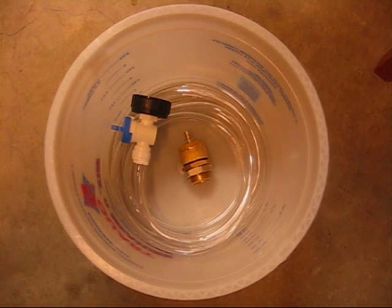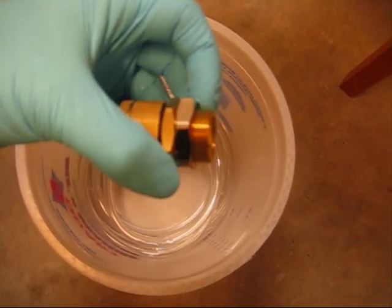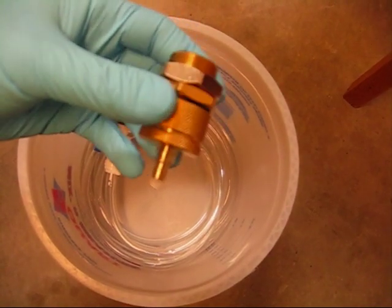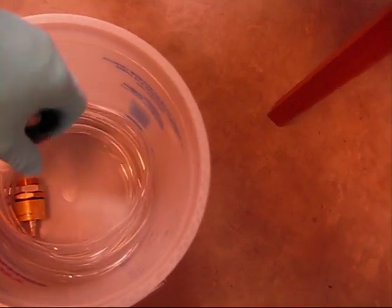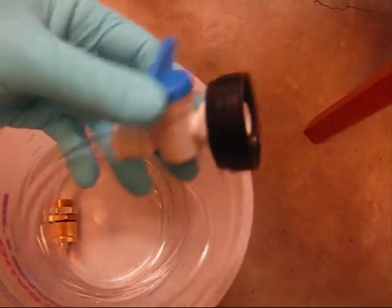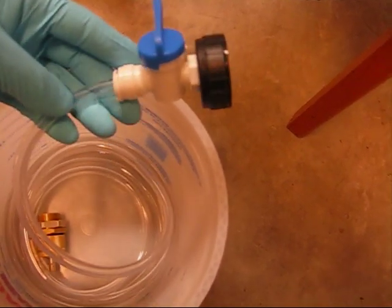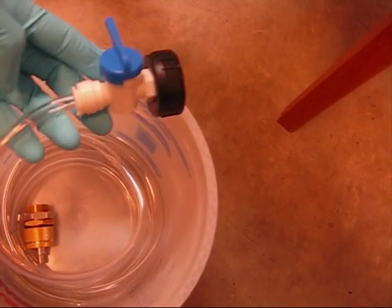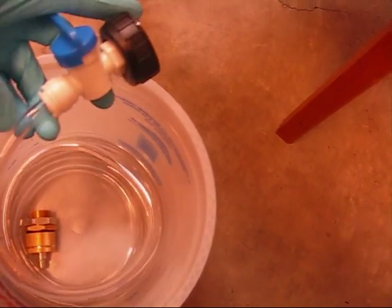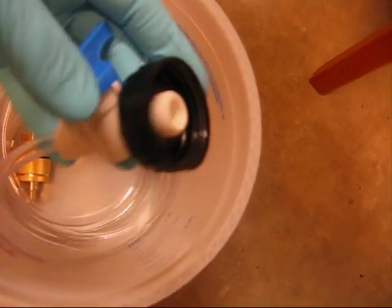Once the oil has drained and you reinstall the overflow tube, the next thing is to install your adapter. The threads are M24 by 1.5 millimeter. You insert this — hand tight is good enough. Then you route your hose through the engine compartment but away from the fan belts or any other moving parts. Position it above the engine compartment so you can attach your bottles. This was from a hardware store, as was this quarter inch line — quarter inch inside diameter, 3 eighths of an inch outside diameter. The cap was taken from one of the bottles.